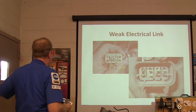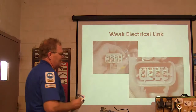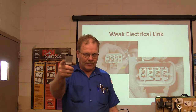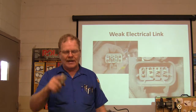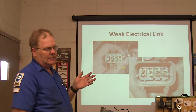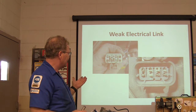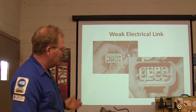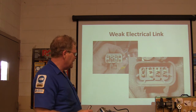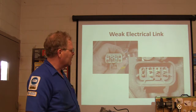This right here was a corroded connector on a turn-of-the-century GM — anyone familiar with those will recognize it. They had a Montana come in that wouldn't start. The fuel pump relay was kicking on, but there was no ground coming from the fuel pump up to the relay. I hooked a test light to the hot, touched it to the socket going back, kicked the gas tank, and the light came on. Turns out this connector — right in front of the left rear wheel feeding the fuel pump — see all that corrosion? That connector was the problem. We got pigtails and replaced the entire connector. It's supposed to be a weather pack connector that keeps moisture out, but it had enough salt splashed in there to screw it up. That was a weak link.